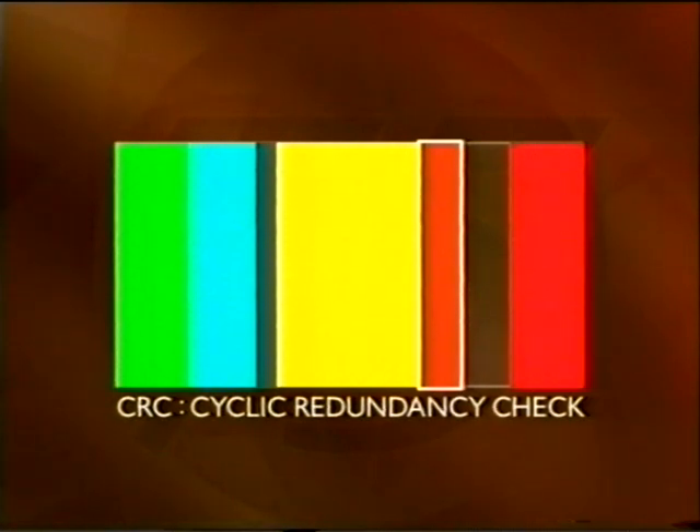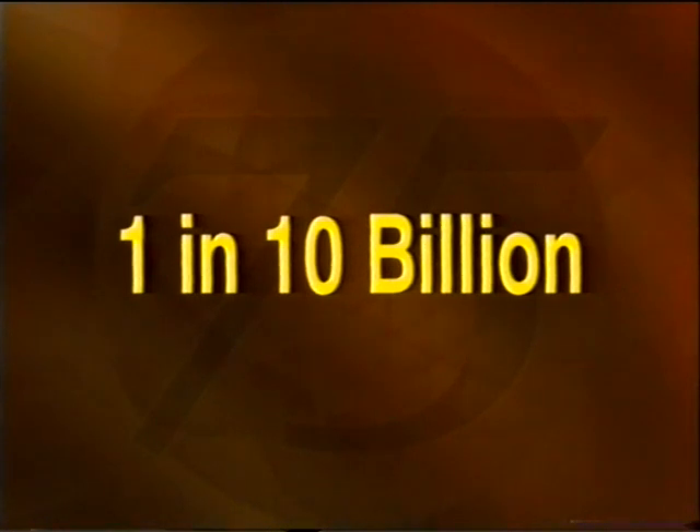Next is the field known as the CRC, which stands for Cyclic Redundancy Check. It checks for message errors, and if an error is detected, the CRC provides instruction to the receiving ECUs to ignore the message. If this occurs, the acknowledgement message is not labelled onto the message by the receiving ECU. The ECU that transmitted the message reads back its own message, recognises the error, and will automatically attempt to retransmit the message in its correct format. Calculations predict that only one in 10 billion messages contains an error that will penetrate the system, and experience suggests that figure is correct, proving just how reliable the CAN system is.